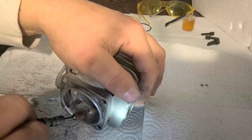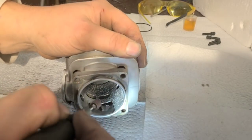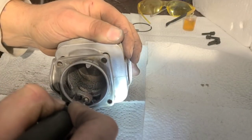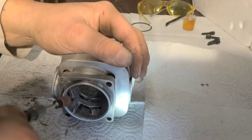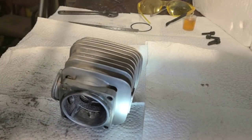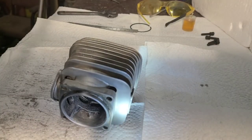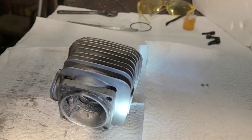When you're doing transfers, be careful when you're in your corners because sometimes the tool will kick up and you'll go across the plating — it does happen. It usually won't go past the plating or anything, you'll just scuff the plating sometimes. Be aware of that and just be careful when you're in the corners because it can grab.